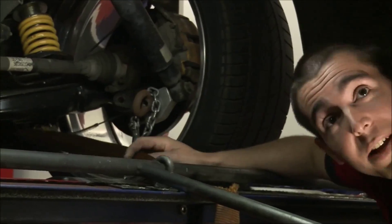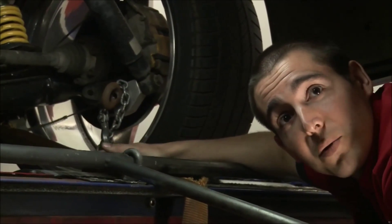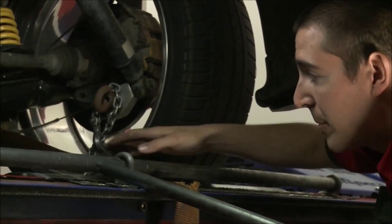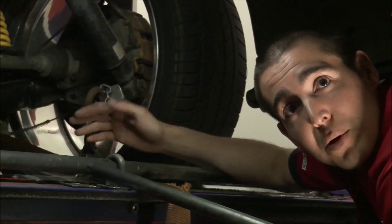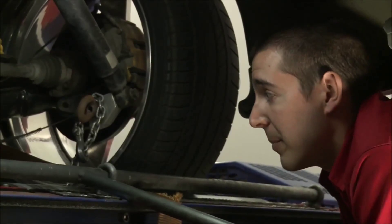What I'm doing here is tying the car down. Obviously a car with this much horsepower — we're pushing for 2,000 horsepower — it's very hard to make the tire actually grip on the rollers. It's very easy to get wheel spin, so we've got to tie it down extremely hard into the front and rear roller.